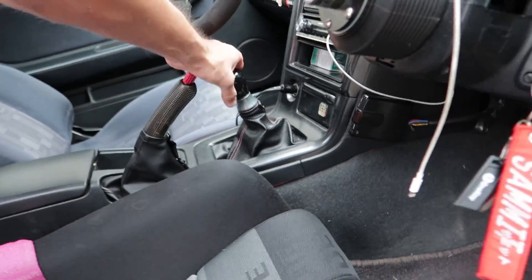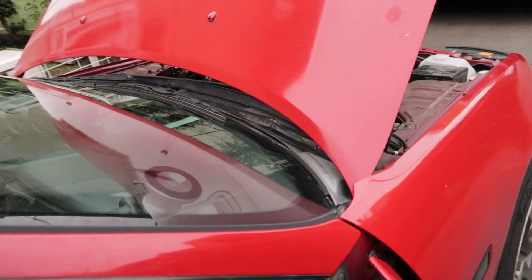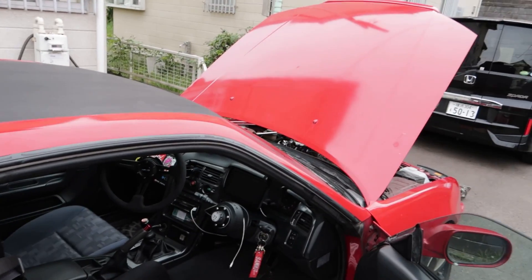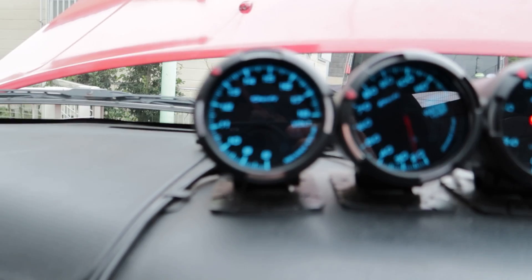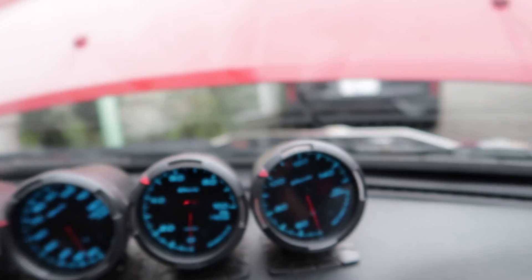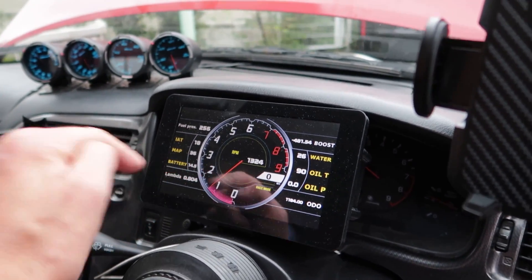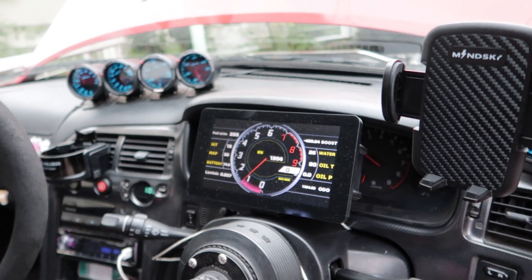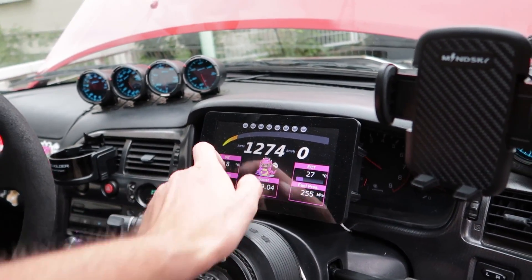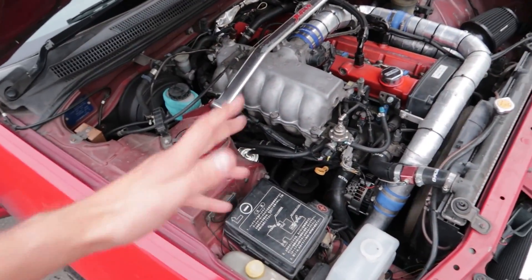Battery's connected again — hopefully she just turns over and we're all good. Straight to life! What's my voltage gauge doing over here? Yeah, we're good. It's hard to see because the light for the needle doesn't work anymore, but we're sitting at about 13.5 there. The digital dash will give a true reading — 14.5 volts. Yeah, that's much better. That's where we should be at. Well, that's solved — took me all of 15 minutes maybe.